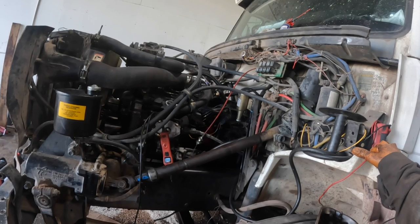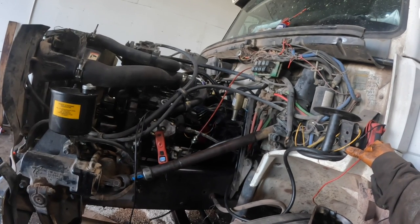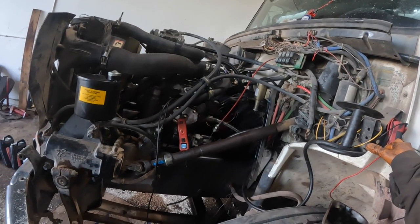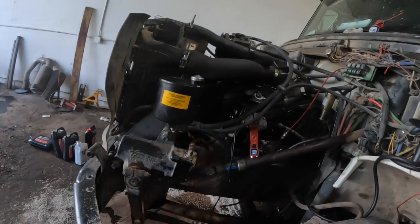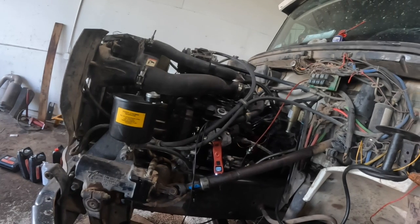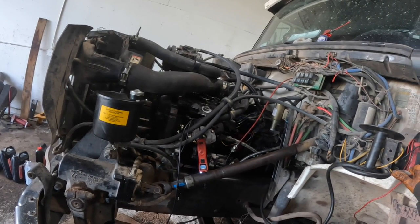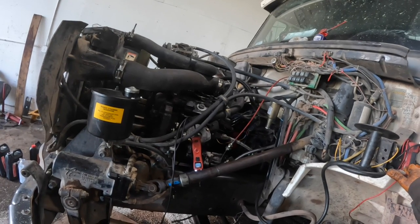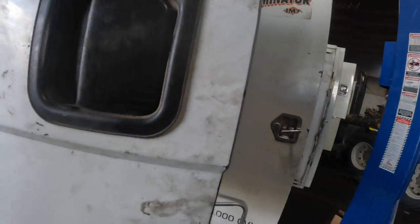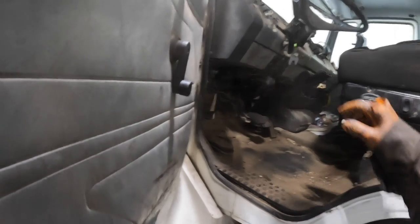So I knew what the problem was. I said, the pump's gummed up, the injectors are gummed up. Fuel gets all lacquered in there. And I was right almost at the point, I dumped all that stuff in there, and I was sitting here running it, and my wife was standing here. She brought this stuff down to me. And I was like, man, honey, this ain't looking good. We might be pulling this injection pump and pulling all them injectors out. Might be going through that pump and might be putting new injectors in it, which I'm putting new injectors in it anyway. But let's see if it don't make a liar out of me, but she finally cleared up.